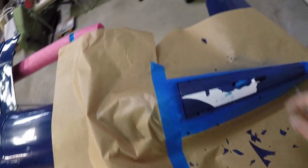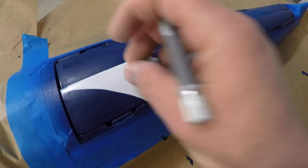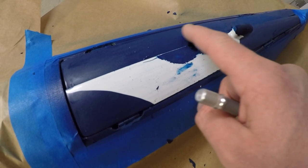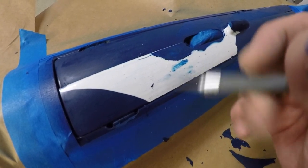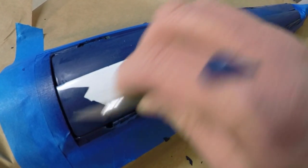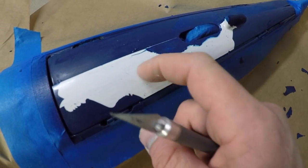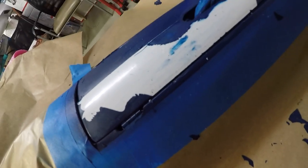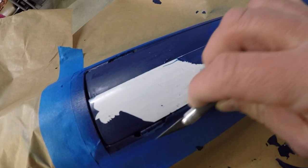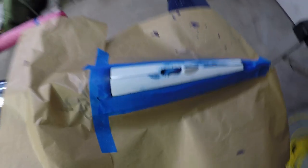I started painting the rear doors and it was a complete disaster. The paint was just peeling off and flaking. When I was getting this ready I sanded it down for a nice smooth transition, but as soon as the acrylic paint was going on it was just coming off in sheets. Very unimpressed with the prep that went into the painting of this door — it's pretty shiny. I've got to pull all the paint off now and basically start from square one on the rear doors.